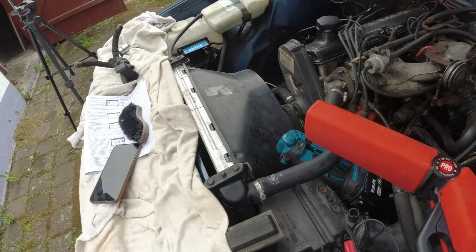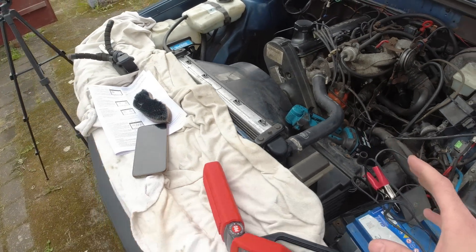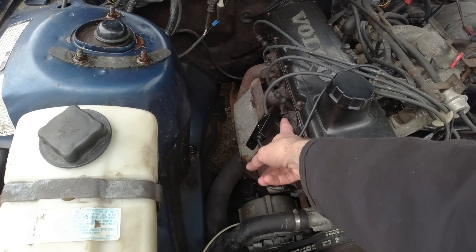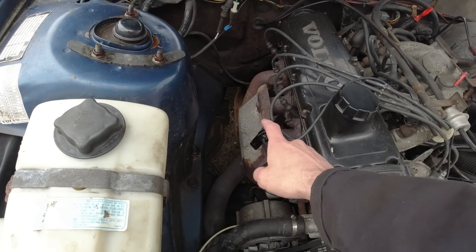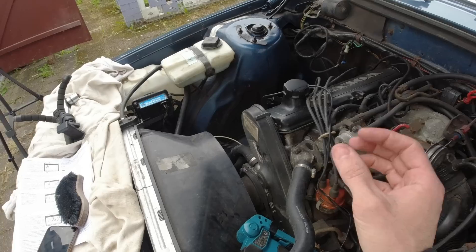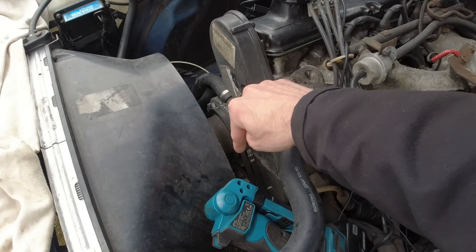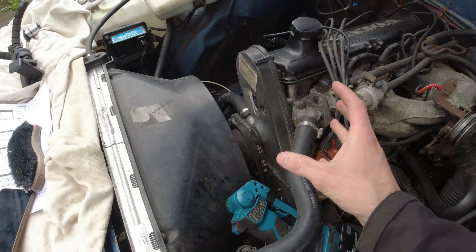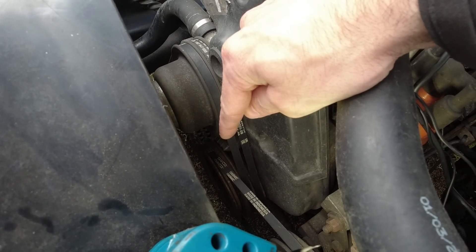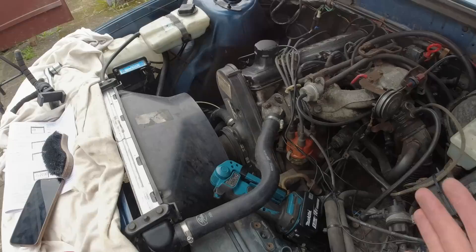The timing light will flash - you've probably seen this before. This gun emits a flash down here at a certain point. In a nutshell, it will flash when it gets a signal from this spark plug wire. When the spark is sent through this wire, it sends the signal to the gun which makes it flash. That shows you where you've got that spark, and you want that spark to happen at the right point. Those markings should be in a certain position when the flash occurs, so you'll be able to see using the marks where the mark on the dampener pulley lines up in relation to the mark on the plastic cover.